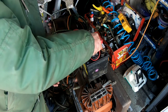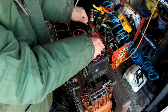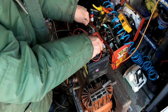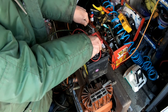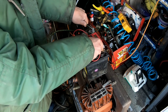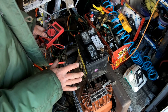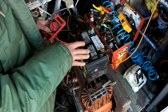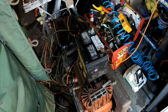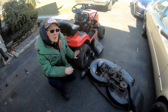It should be like 12.9, 13, something like that. It says 12.3. That's not good - it just came off a charger. Why is it 12.3? That's terrible. I don't think this is going to work. I think this battery's done, but I'm not going to give it a big done yet. I'm going to wait a day and see if that 12.3 goes down to like eight or something, and then you know it's done. But if it maintains 12-something, it might have some hope. Maybe I'll try some distilled water in there.